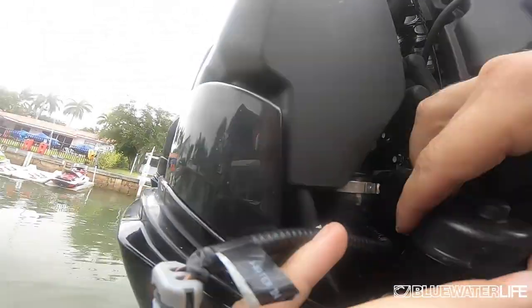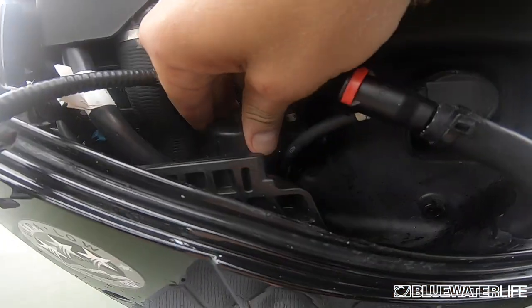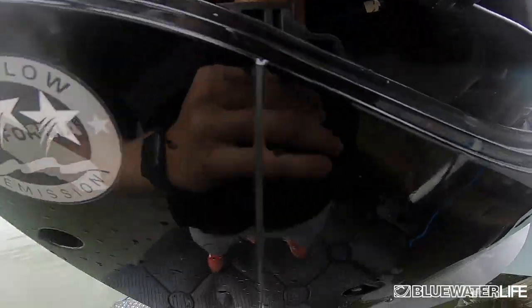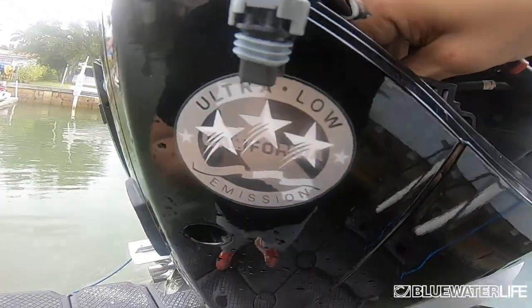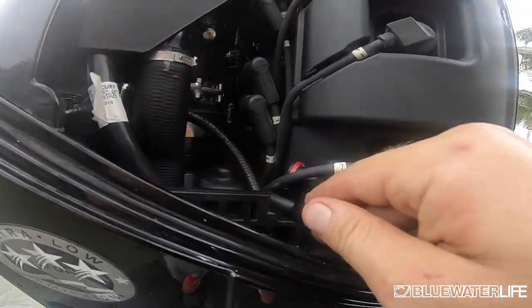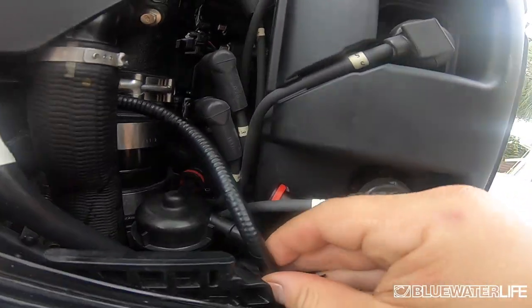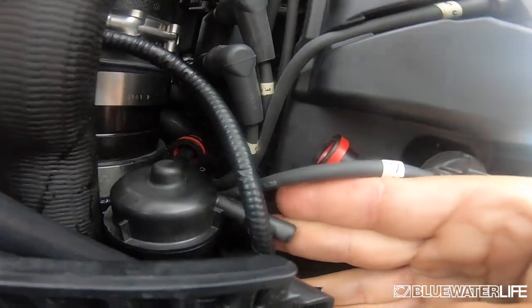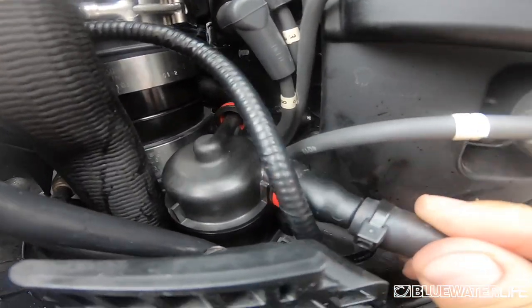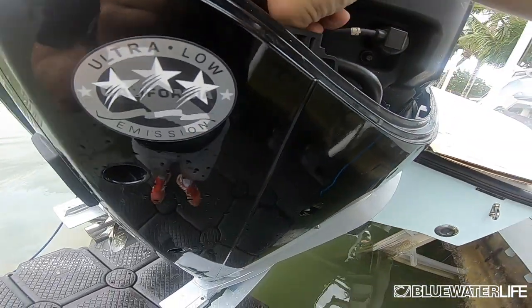To reinstall the fuel filter, there's a groove on the bottom, so put it in and turn it — you'll feel it tighten into place. Just don't overturn. The two red connectors go on next with the harness. I usually put the harness in first since it's under the connector and a little easier to get to. All three connectors will click into place when you put them back on the fuel filter.